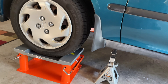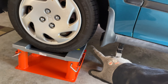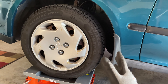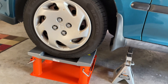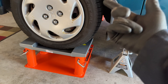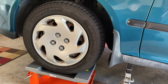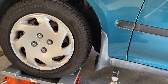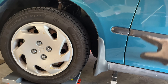Another important thing about supporting your car on the wheel rather than on jack stands: if you do any suspension work that needs the suspension to be loaded for you to secure the bolts, your suspension will be tightened under load — the MyLift stand gives you that opportunity. If you jack it on jack stands, you're going to have to load the suspension artificially on a hydraulic jack. Also, if you work on bodywork, I learned from working at a body shop in the early 90s that the car should be on its wheels and not on stands in order for the body lines to be right.